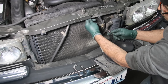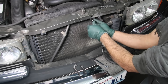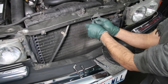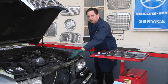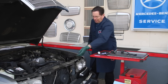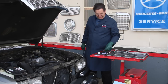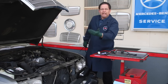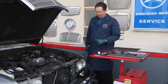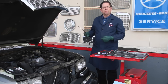When I got tired of fighting these cables, I went to work and came up with some special tools. Here are the special wrenches I came up with — now aren't those crazy-looking wrenches? Those wrenches are designed to get underneath this core support and get those two nuts loose. You need to do that whether you're removing the cable or just adjusting it — if you have to pull the lever all the way out and pull really hard, it may just mean you need to adjust the cable length. We had to grind the heads of these wrenches really thin to get in there; one is offset one way and the other is offset the other way. On this car you do have to remove the auxiliary fan, but on the 123s some models you can get in there without removing anything.